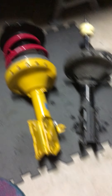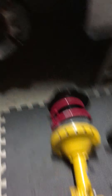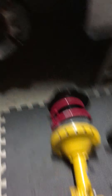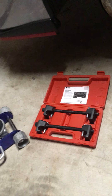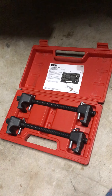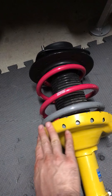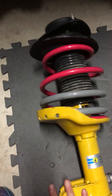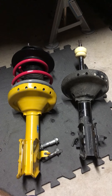The manual doesn't want you to do it that way — they want you to remove the two bolts on the bottom and then the one at the top, but it's really difficult getting out that bottom bolt in that area. Anyways, it's supposed to be an easy install. Putting the strut in and taking it out was maybe 20 minutes, it really didn't take very long. But getting the spring in there took forever because this probably is not the right McPherson strut compressor to use.